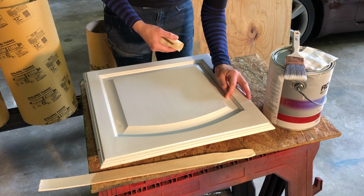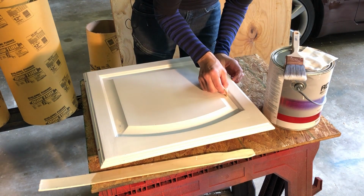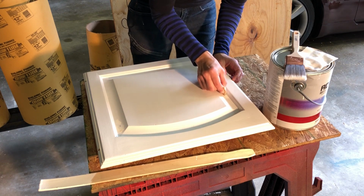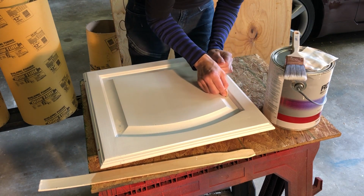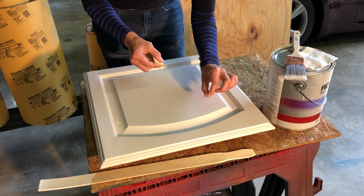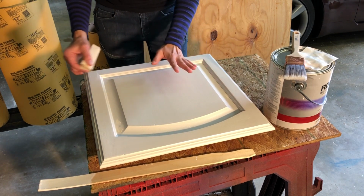You know what, since I'm doing this, why not just pick out some of the other stuff that I'm seeing now? Just made a little hole there. If you pick out a little grain of sand or something, you definitely want to give a little sanding treatment to that area, because otherwise you're going to have a little hole with a raised edge, because that is what happens whenever you pull a tiny piece of dirt out of your paint. It raises up the edge as it comes out, which is pretty rude, and then it leaves you with a hole. Okay, those were the only 3 spots.